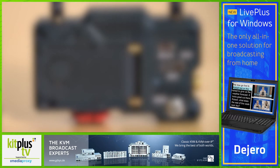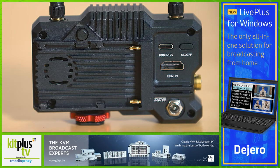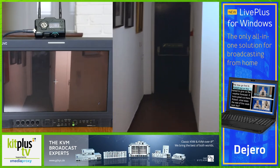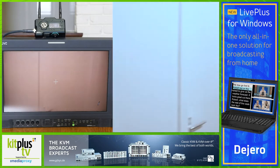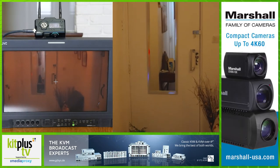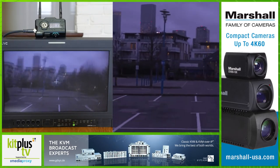There's also a USB-C port, which is another nice feature as it enables direct connectivity to a computer for live streaming, for example. In my test the transmitter ran for just over 10 hours from a fully charged NP-F mid-sized battery. It transmits 1080p at up to 60 frames per second and in my test it could be picked up at a distance of 350 feet through a wall.